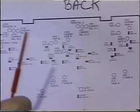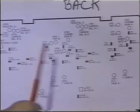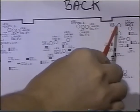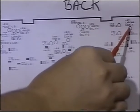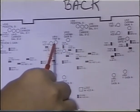You use something like this from Radio Shack. It's a TV adjustment tool to slightly turn counterclockwise or clockwise to the adjustment that you want while watching a split screen view of what's going on. And remember, it's very important when you make these adjustments to only adjust one parameter at a time, one of the channels, to make sure you're happy with it before going on to the next adjustment.